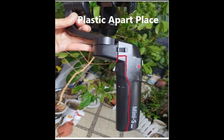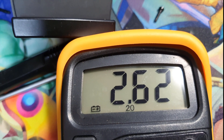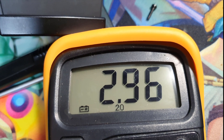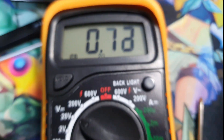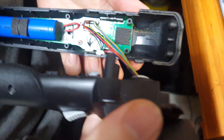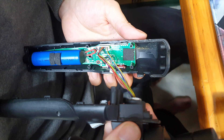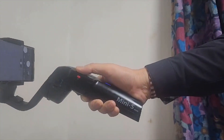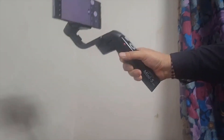Next, if you check the battery condition with the tester, you can judge it by the voltage reading. I found no problem with the charger since the battery showed 3.5 volts, within the normal 3-volt range. For the other parts, I tried to fix the fault by removing the connection terminal and reconnecting it. After connecting the charging power, the light came on. I decided there was no problem and reassembled it. After charging was completed, it was confirmed that it worked as before.